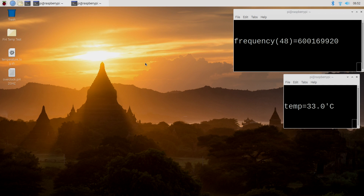What's going on guys? It's ETA Prime back here again. Recently there was some new firmware released for the Raspberry Pi that actually allows us to overclock up to 2 GHz. Upon the initial release of the Pi 4, there was a hard limit set with the firmware at 1.75 and there was no easy way to change this. But now with the updated firmware, we can actually overclock our Raspberry Pi 4 to 2 GHz. Stock is 1.5, so that's a 500 MHz gain and it's actually pretty decent for a small single board computer like this.